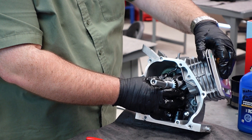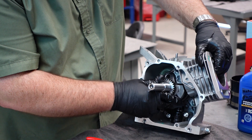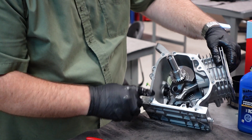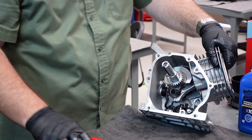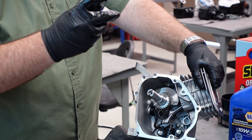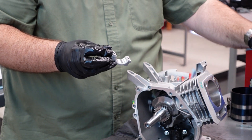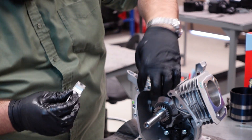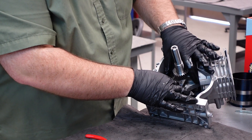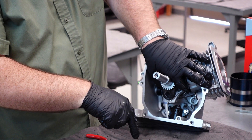Now I'm going to take my left hand here, push the piston down so it seats on that surface, and roll the whole unit around to about center of the bottom. Now I'm going to take my connecting rod, oil slinger arm down, making sure that I'm clean here. I have a little bit of lubrication on my bearing surface, on your journal surface. Then you can install that arm — oil slinger down.